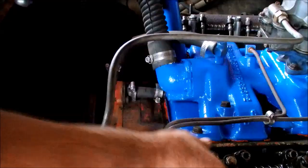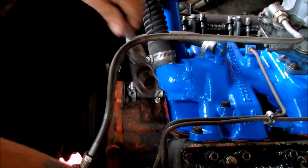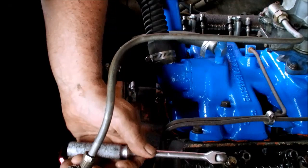Seems a little tight. I am adjusting these at 15. The book says 19. These valves are notorious for rattling because of these solid lifters. There's a guy on YouTube that recommended this method. Now I want to loosen that. He said that he adjusts his at 15, doesn't have any problem with them, so I'm taking his lead and going in that direction.